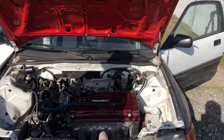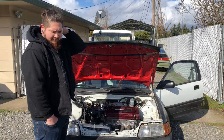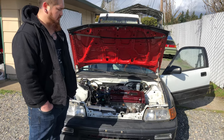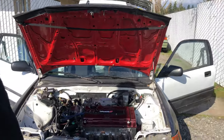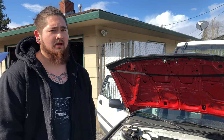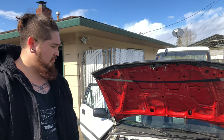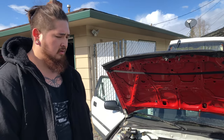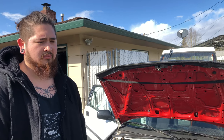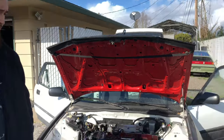The B17 is coming out. They're going to do a B16A — Matthew already has his old B16A from before the car got stolen, so he's just going to rebuild it and put it back together. For boost, he picked up a cheap Emusa turbo setup and plans to run 16 pounds, shooting for 300 wheel horsepower this year. For internals, he'll do a head gasket and ARP head studs — the engine was pretty sound before, just had a bad head gasket leak after the theft.